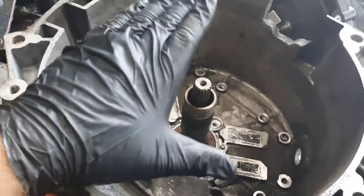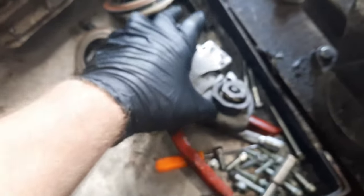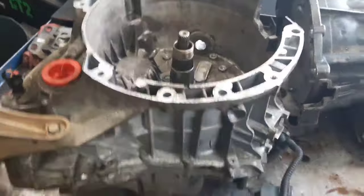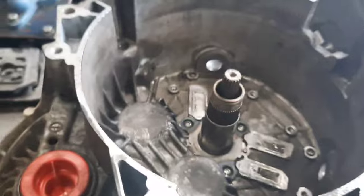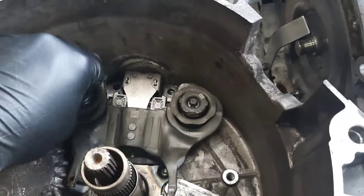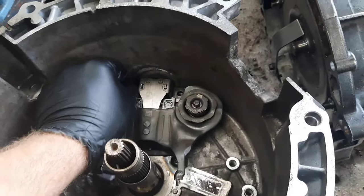Don't forget your shim here - make sure it's sitting evenly and tighten all the bolts down. I won't be showing the full reinstallation of the transmission today due to time constraints, but I will give you tips. That mainly involves the torquing of the clutch nuts. There are six clutch nuts - first thing you want to do is turn the engine with the transmission in the car with the new clutch - turn the engine over about eight times to make sure the clutch is set properly against the flywheel, otherwise you'll have vibrations.